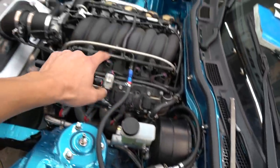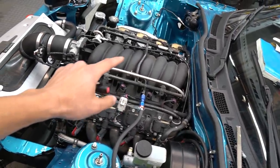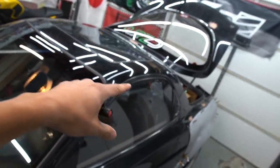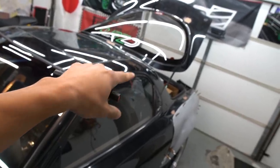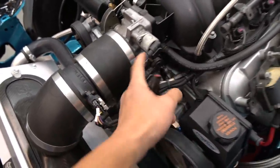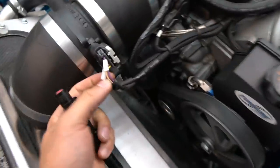This over here is an ugly-looking yet functional fuel filter and fuel pressure regulator combo piece — I'm going to be relocating this to the back, but I don't care so much now because I'm going to be going with bigger injectors. I've already got a fuel rail from Radium Engineering that I'm going to be installing. All new fuel lines and a new fuel pump in the back — I'm also thinking of running a fuel tank baffle system for fuel starvation prevention. As for the wiring, I went through every single pin on this car and labeled it as much as I can so I know which wire goes where.